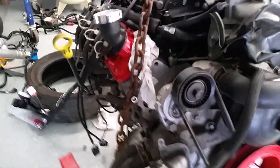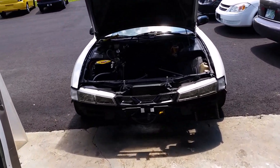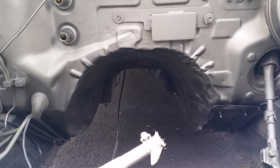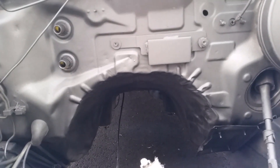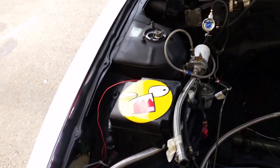Since then we also did a new serpentine belt and went through the engine one more time. Here's the Siki power steering line. When I had the engine out, we bashed the tunnel in to fit the T56 bell housing — approximately an inch to an inch and a half deep and eight inches in. While we were doing that, I applied an industrial coating to the firewall, fenders, and engine bay to clean it up before the LS1 goes in. Next we're going to install the motor mounts into the LS1 as well as the transmission mounts and begin the process of dropping the engine.